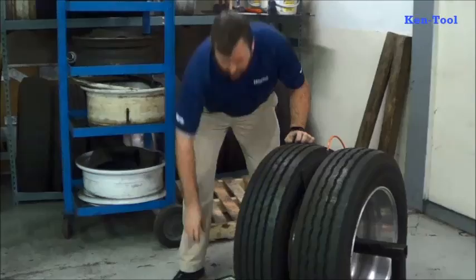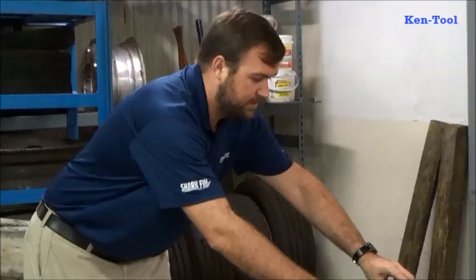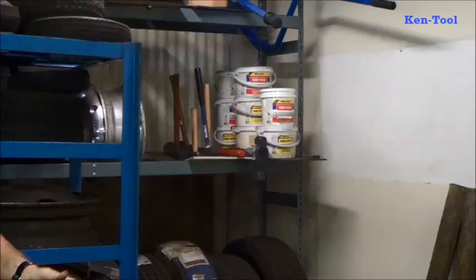Coming along over here, we have two items for dual-wheel separation. This is our mechanical dual-wheel separator — be sure to tell your customers to spray this before every use. It goes between the wheels, clips on, connects to your impact, and separates the wheels. Hidden between the wheels is our shark fin bag — a pneumatic bag used to separate wheels when they get stuck, featuring no metal-on-metal contact. There's a nice product offering from cages to irons to four-ways and specialty truck products. Hope this serves as a great introduction to Kentool and gets you on your way selling some products.